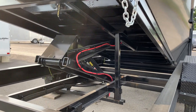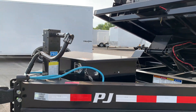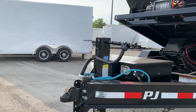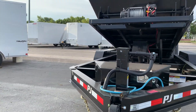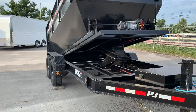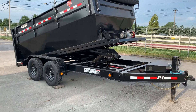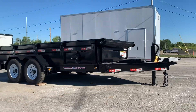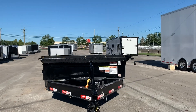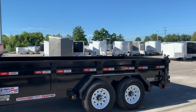The last question I hear often — not just related to dump trailers — is what is the carrying capacity of my trailer. To answer that, you need to take the GVWR and subtract the weight of your trailer. A 14K trailer means you'd likely have 10,000 pounds worth of capacity because the trailer itself probably weighs in excess of 4,000 pounds.